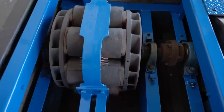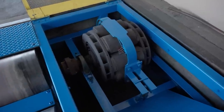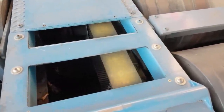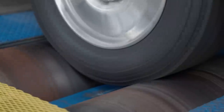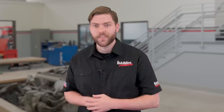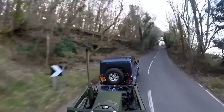What we're looking at here is a dual roller eddy current setup. I've got the cage off, and this is the power absorber itself. That one is directly coupled to the front rollers. We've got a mirrored piece on the opposite side, and then a center belt drive to couple it to the rears, keeping the same ratio front and rear. An eddy current dyno provides load from an electric core moving across a magnetic field. The charge acts as a large brake and applies the load to resist the rotational force on the rollers imparted from the wheels of the vehicle. With this power absorber, we can dial in as much load as we want — we can mimic towing load, a steep grade, or even a headwind.